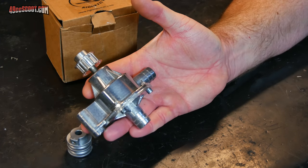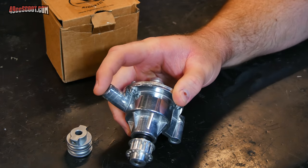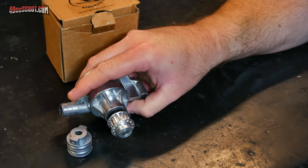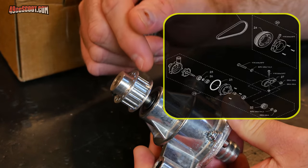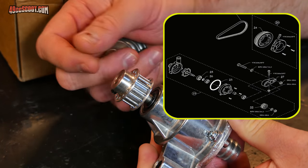This is a mechanical water pump used on some racing go-karts like shifter karts. You can see it's about the right size for the scooter. The outlets happen to be the right size — 5/8 or 16-millimeter hoses — so it works out quite nicely. As you can probably guess by the pulley on here, this is a belt-driven water pump. There's just a pulley mounted to the impeller shaft that rotates the impeller and moves water. It's pretty simple.